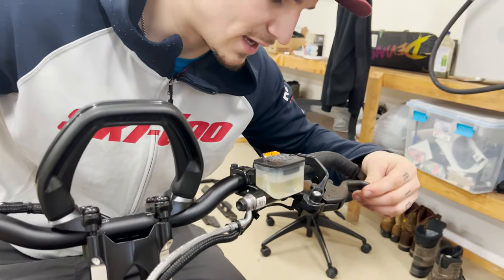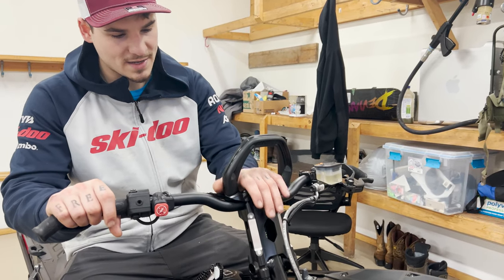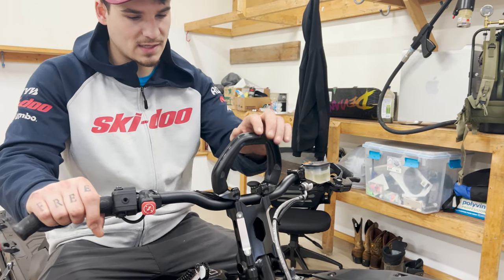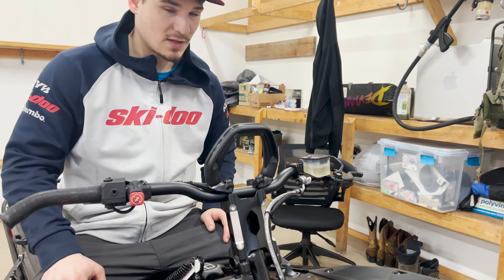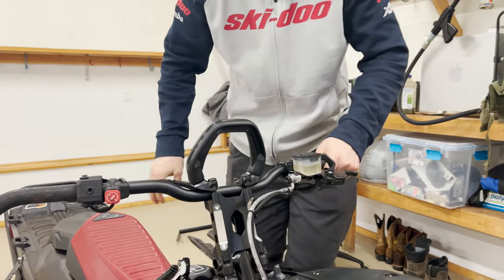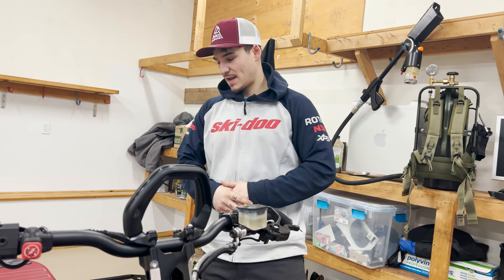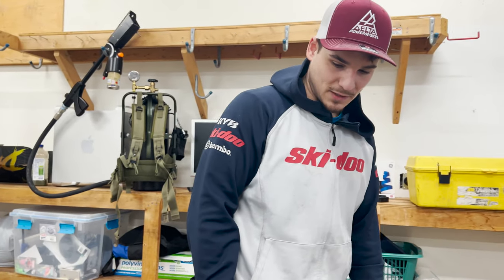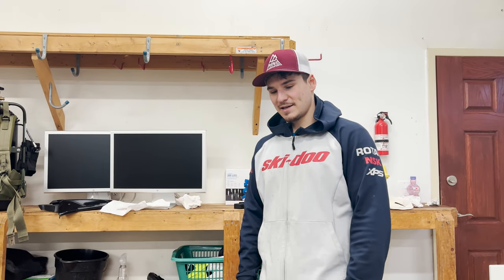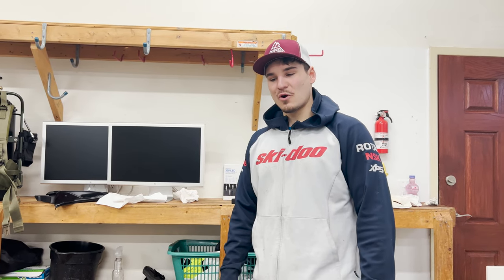I'm really digging this short lever that comes from Skidoo on the Gen 5s this year. The only thing I might want to add is a bar pad here just for some extra safety — I don't really need the rookie handle. I keep the sled pretty much all stock, and that's why I'm really pumped about this sled. I might shim up the springs a little bit and continue to adjust the suspension as I learn more about how the sled's reacting. Hopefully this helps you guys tune your sleds up to ride more aggressively or just learn a little bit more about how to adjust your sled. Thanks for watching!